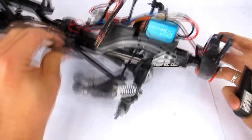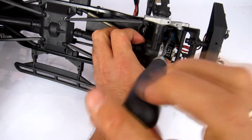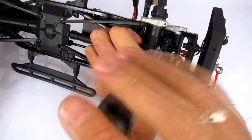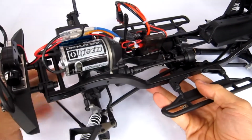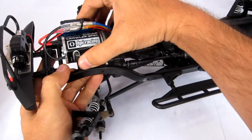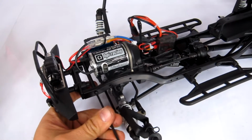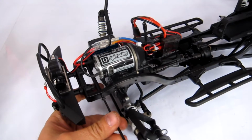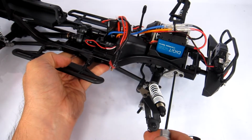So underneath we've got the screw holding on the servo horn. This is just the main link that connects the servo to the actual steering links. So there we are, and we should be able to lift everything out. Sorry, my bad. We're actually going to have to take off 3 more screws that are holding on the front bumper, because we're going to have to spread the chassis rails out just a bit. So that's the second button head screw that we're taking off. That one's fairly easy to remember because it's the only one that we're going to be dealing with like that.